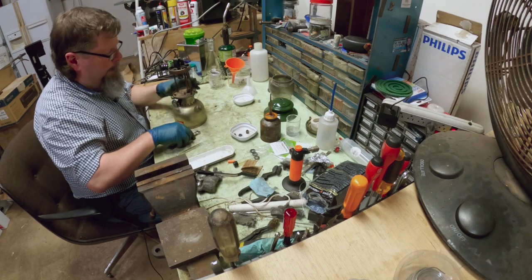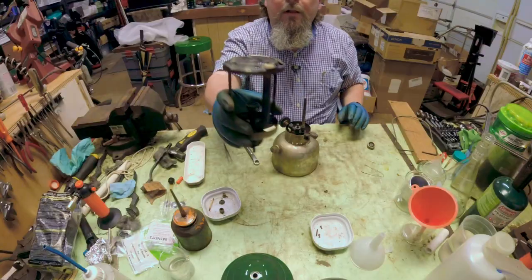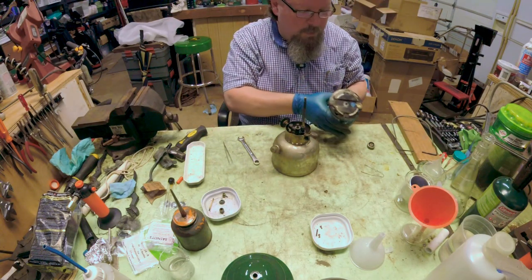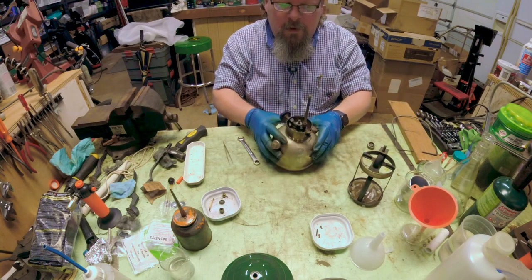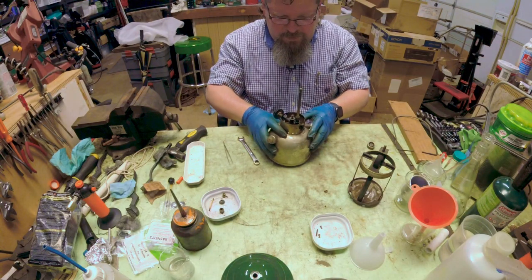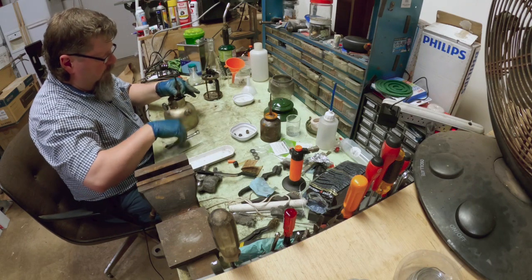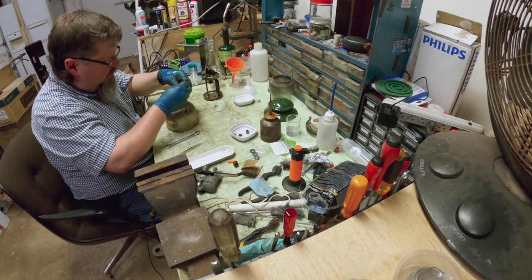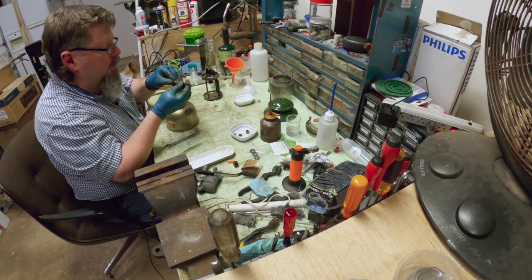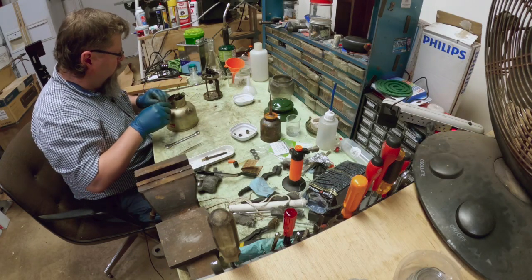Don't mind the rain in the background. I can see that the air tube at the bottom is completely occluded with what looks like a mud dauber nest or spider nest. When I look at the end of the generator it's got very much the same — something has built a mud nest on it, so that's probably why we're not getting any flow. I'll pull the generator out to check — yeah, the needle is completely missing, so this one's going to need a replacement pricker. The generator's probably fine but the pricker is ruined because the needle is gone.